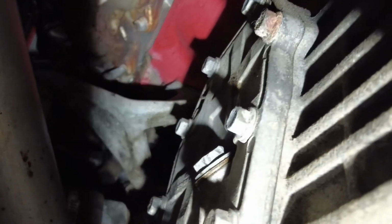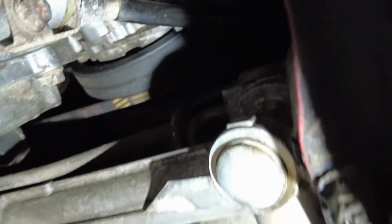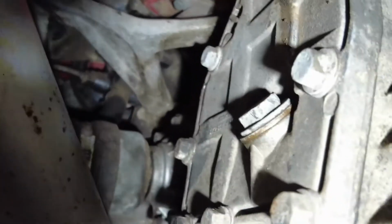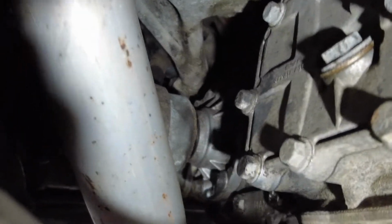You see the engine head. The engine belts on this Saab 900 are facing the cabin. So if you look at it, here's the pulley. You can see it right there. And the transfer case and the differential and the gearbox are below the engine. Basically, they work as an oil pan. So the engine sits on top of the transaxle.